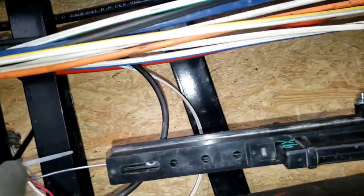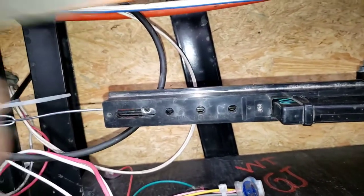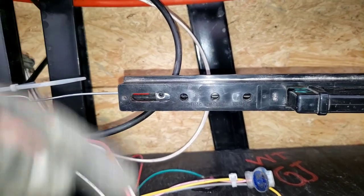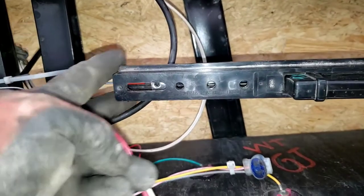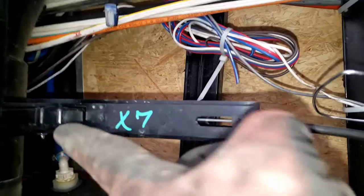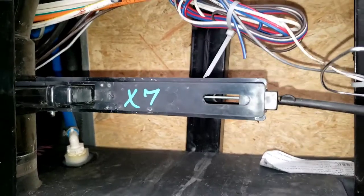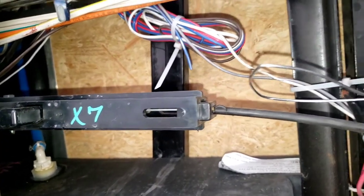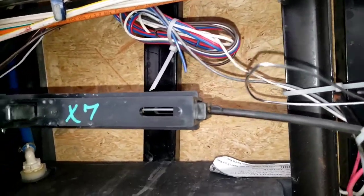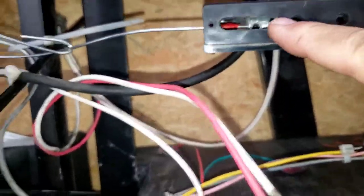When I put it back in I'll put some silicone plumber's grease on there so it opens and closes easily. I'll set this valve in, push it all the way in, and then make the adjustments. I've already turned it upside down because this is where everything is going to be accessed. If I ever have to do my black or my other gray tank I'll just flip this around so I have access. Get in here and just flip these around because it doesn't make a difference what side that goes on.